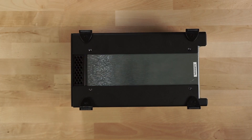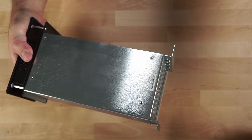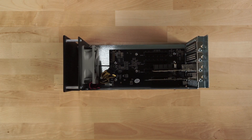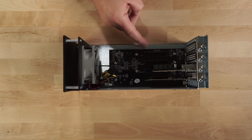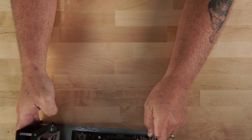Now that the four screws are off, just simply slide the cover off — just like that. Here you can see the inside of the actual chassis itself. Being a three-bay enclosure, you have three PCIe card slots. I already have a 10-gig networking card in there from when I was using this enclosure with my 2018 iMac. So we're going to install the DeckLink Duo 2 card in one of the two available slots. For now, let's just move the enclosure off to the side.